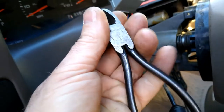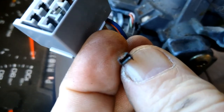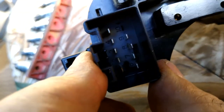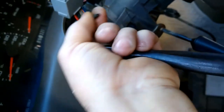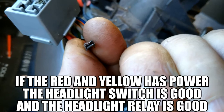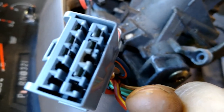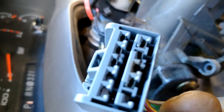Take a set of regular wire cutters — I pinched it down a little bit. Then I touch-fitted it on one of those just to see how snug I could get it, because it would just fall off if it was that sloppy. And by pinching it down, now it's getting a good connection. All I've got to do now is pop it back in the plug and put the little retainer clip back in and plug it back up to the multifunction switch.